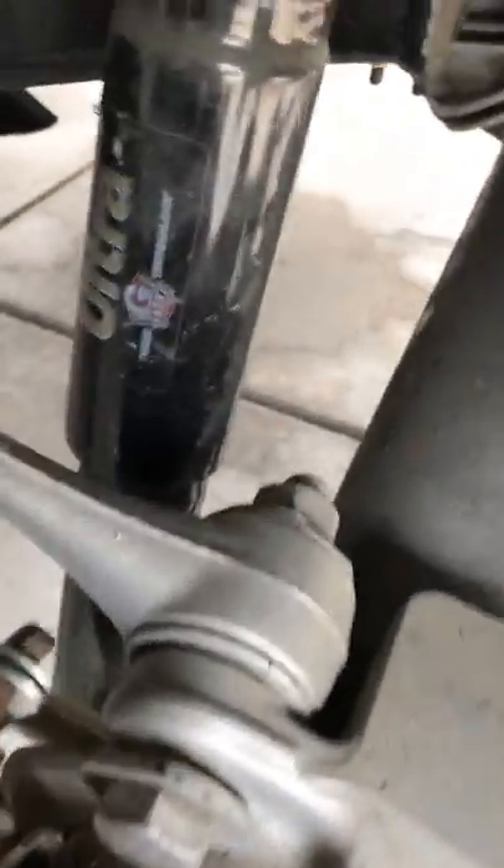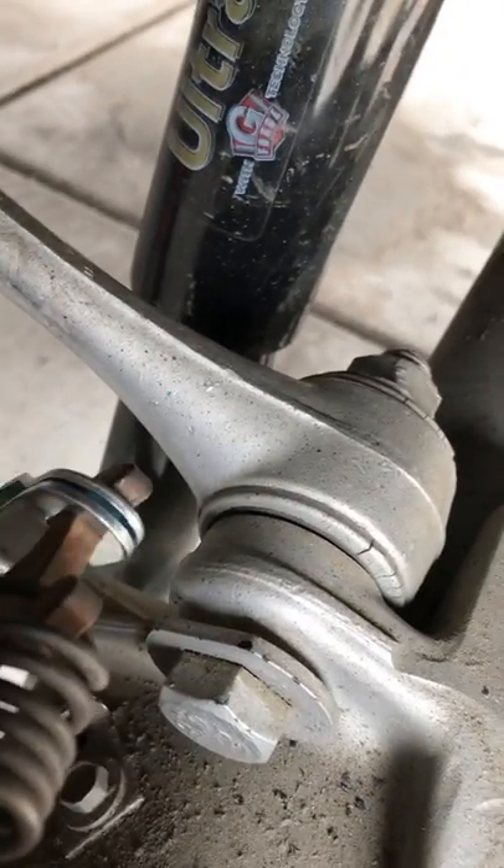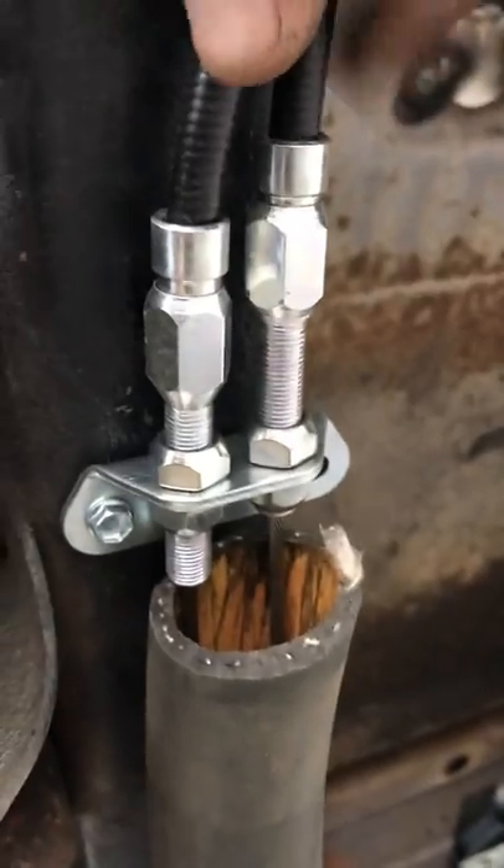Let me give you a quick overview. There's the clip that replaced the original one on the caliper — this clip here replaced the stock one. Where it used to sit on the caliper, this new piece just bolts right in there — I didn't have to cut anything. You can then route your cables how you need to. This short cable came up and over the frame, back out, and under to the junction piece. The other side is the same, just a different route up and over, avoiding the driveshaft, then back over to the caliper.